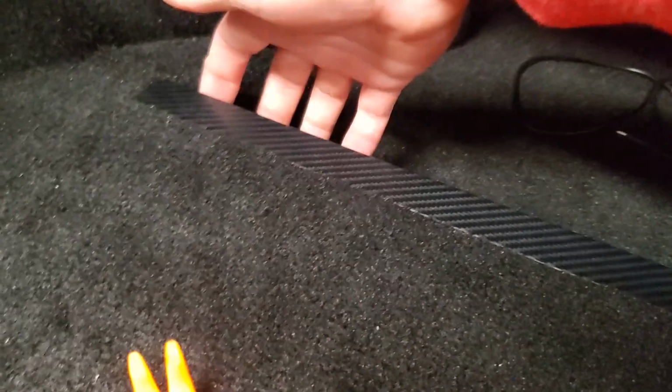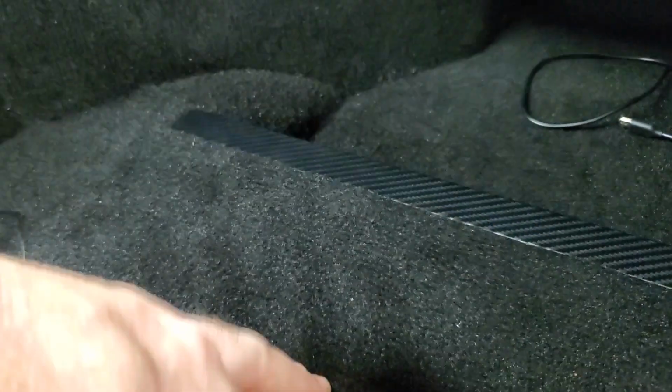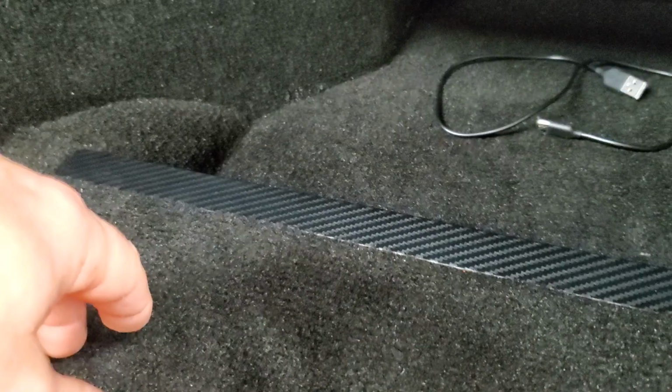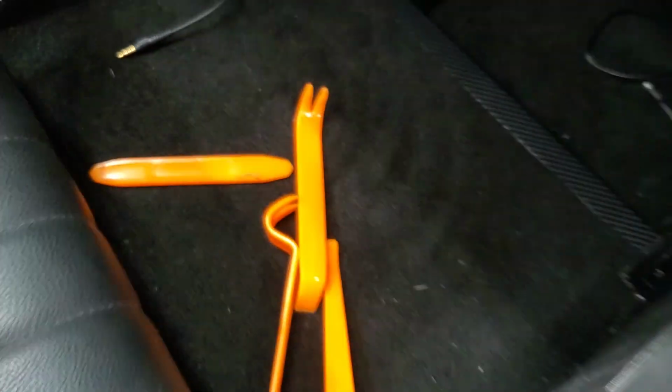It works out really good with the carpet. I made this aluminum piece. This is just an aluminum L. I shaped it around the bottom of this round tube here. So it does have a curve here, but it's screwed in 3 times in the front of this. If you've not done yours yet, the carpet just ends at the front of this thing here, and I'm sure that people kicking their feet in and out of the foot box would probably keep that carpet peeling back time after time. So anyway, that's going to keep that carpet pressed down permanently. So that's what I did with that one.